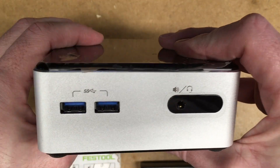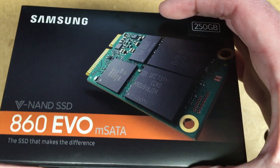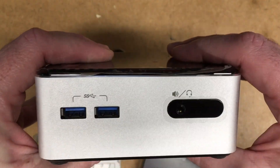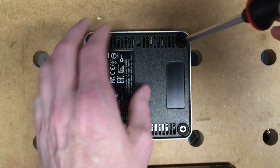I've been using this as a Linux desktop for quite a while. What I want to do is install Windows on it, and I'm going to install that on the M.SATA drive. So the regular SATA drive will have Linux and this one will have Windows on it. I know you can install both on the same drive — I just want them separated.